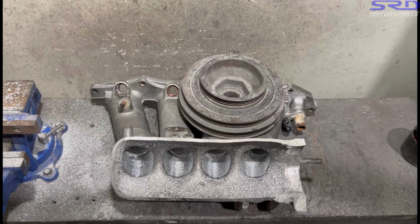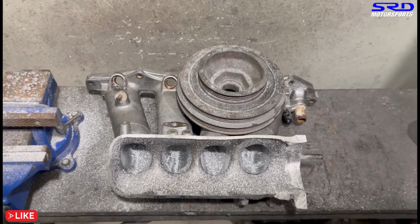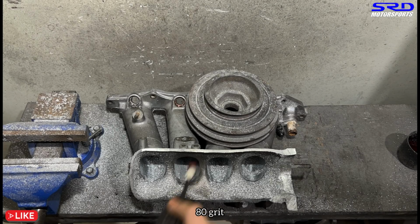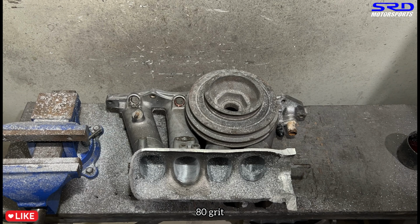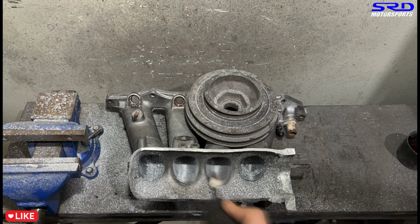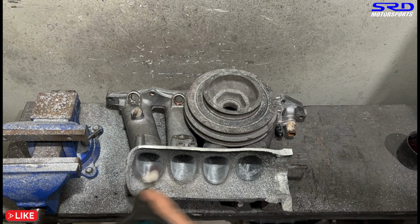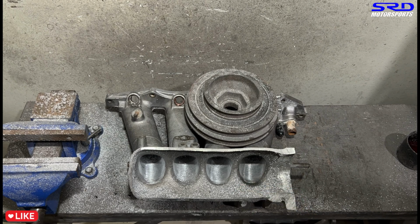And so here we are after a few more passes on the carbide. As you can see, there's more debris. Now we can go straight to 80 grit for now. So here it is, 80 grit. Trying to get the shaping good, because you gotta see it smooth enough on the 80 grit to see even more if there's more bumps or ridges, because on the carbide alone it's gonna be hard to see, since they're textured rough.